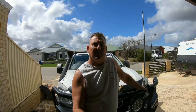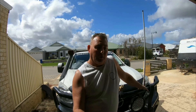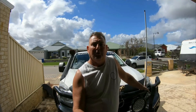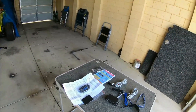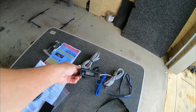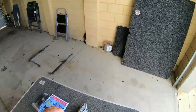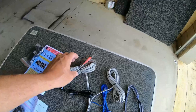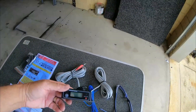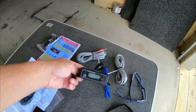It'll give you an audible alarm if you start to lose water through your cooling system in your motor. So I'll show you what it looks like. Basically, this device right here is the Engine Watchdog. It is a device that has two thermo cells — this one goes to the head of the engine, the second one goes to the transmission. This is a dual port unit. You can also get a single port unit that just does the head temperature alone.